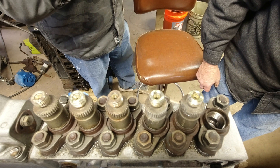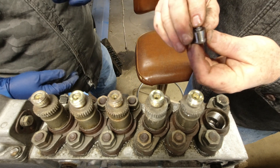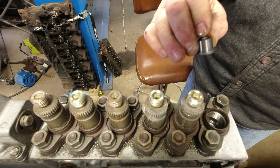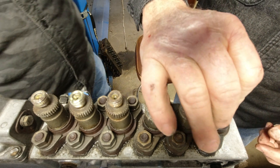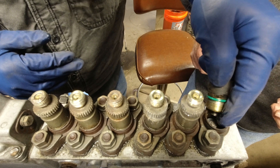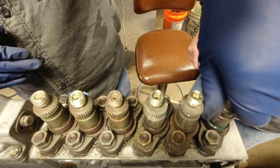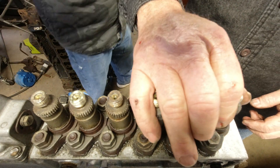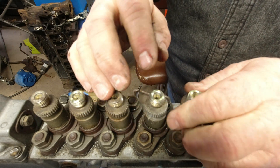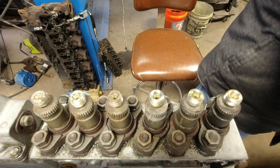New delivery valve here — it comes assembled just like it sits. You drop it in and, I know this looks funny, it has a flat bottom on the stock one and this one's bigger on the bottom, but trust me, it goes in like this, just like they come in the package. Drop in power. Lean it over, make sure your spring's good and you can seat it on top of that cap. Run it in with your fingers, seat the o-ring. We'll show you the torque sequence in a few minutes.